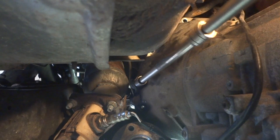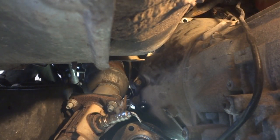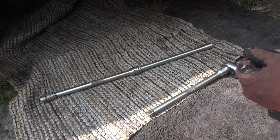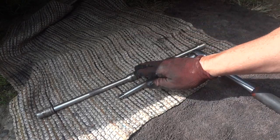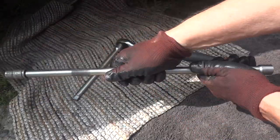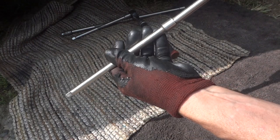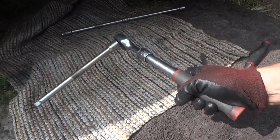Here's where we're at: all the bolts are out of the bell housing except for two that I've backed off about a quarter inch. For the top bolts, this is not a three-eighths drive situation — use a half-inch drive. Here's why: with a long extension, the half-inch won't flex. With three-eighths extensions chained together they start to flex, and when that bolt breaks loose this whole setup can fly apart. I find it so much easier to use a good half-inch ratchet and extension with a 14 millimeter socket for those transmission bolts. Get the back end tipped down and snake your hand up to start the socket on the bolt — I didn't even need a swivel socket.